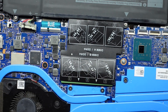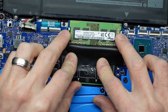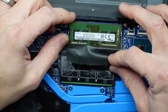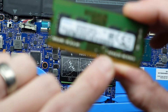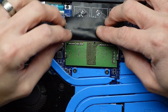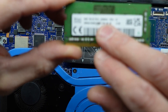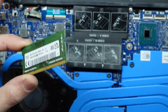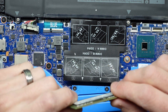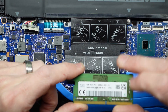Now I want to see what RAM we've got here and whether it can be upgraded. Looking at it, we have 4GB of PC4 3200. To remove it, push the metal tabs on the ends out. The other stick — fold it out, lift up, pull it out — we have 8GB of DDR4 3200MHz. So this was not operating in dual channel mode. Typically if you have matched size and speed of RAM it will run in dual channel, which usually gives about a 10% performance boost in video games. So you could have a single 16GB or two 8GB sticks — the two 8GB will outperform the single 16GB.